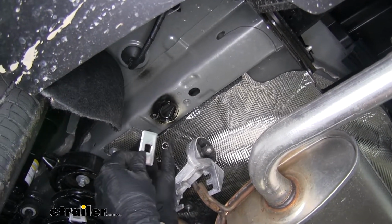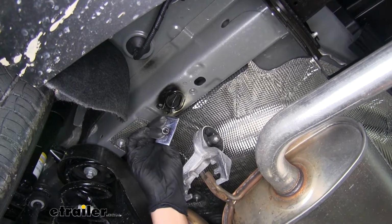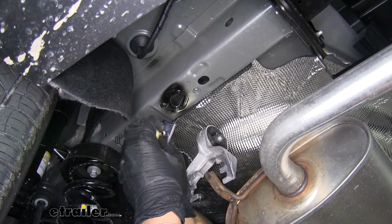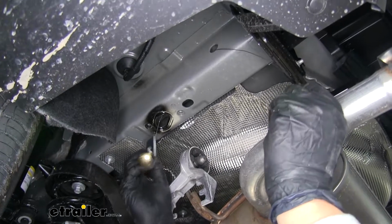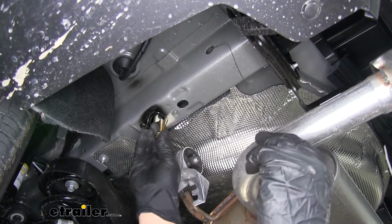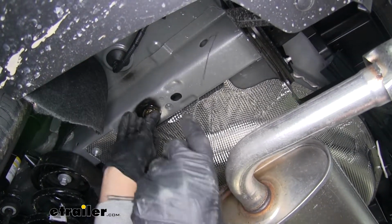We're going to take one of our square hole spacer blocks, we'll feed it over the end of the coiled wire, and we'll take our carriage bolt and we're going to thread it on. You're going to want to feed each piece in one at a time. So we'll feed in our block, and we'll push in our carriage bolt.